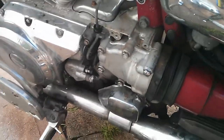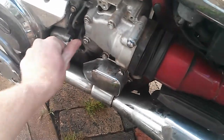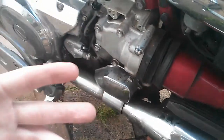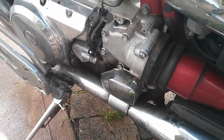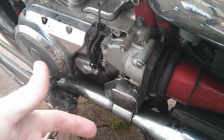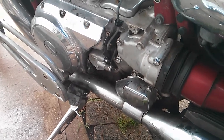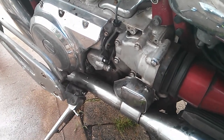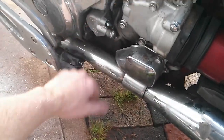On some vehicles — and some motorcycles too — you can gravity bleed it: you just pour fluid in the reservoir and the lines fill up, then you drain it out, lines are full, and you can apply pressure. My car is like that, which is super easy. I changed out my slave cylinder and I just had to add fluid, pump it a few times, and I didn't even have to bleed the system.